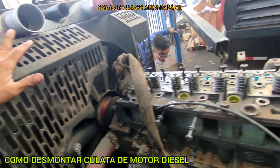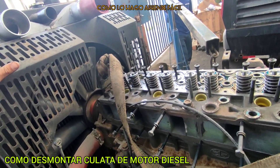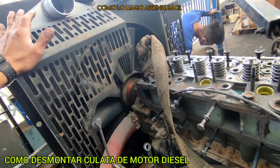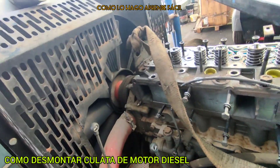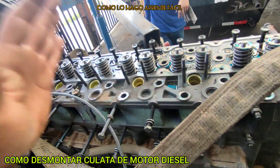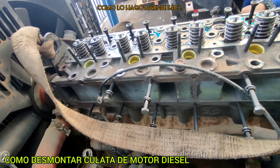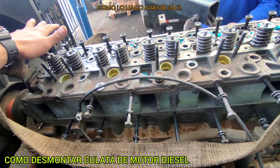The gasket is compromised and it ends up expelling the water with great pressure to the upper zone. In this case, it can also be detected by submerging the system in water and observing bubbles. So it is mandatory: we have to remove the culata, do an inspection to verify it is not fissured, and if everything is fine, simply replace the gasket.